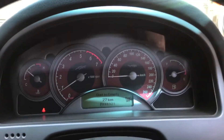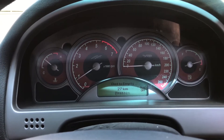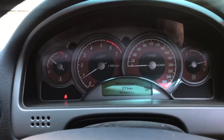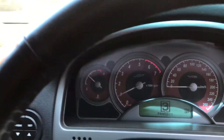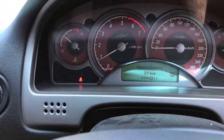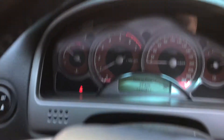I'm going to do a quick stall test. This car's got a three grand stall in it, so I'm going to try and stall it up. We'll see how much stall we get out of it while my foot's on the brake, and that'll give us a bit of an idea of what the converter's rated to, stall-wise, and when we break traction because we can't hold the brake any longer.